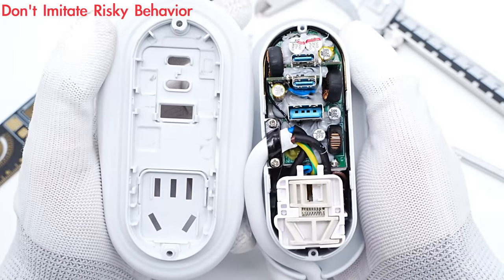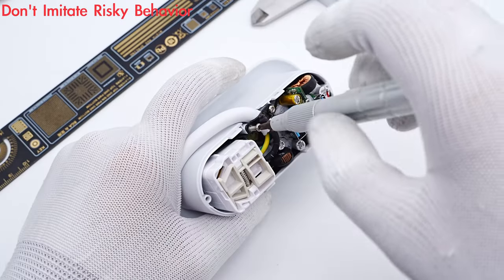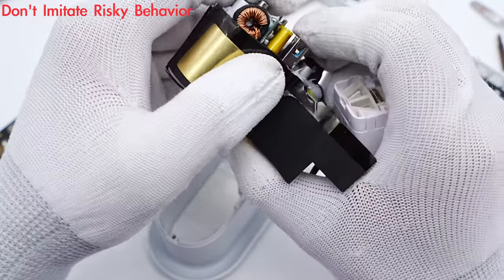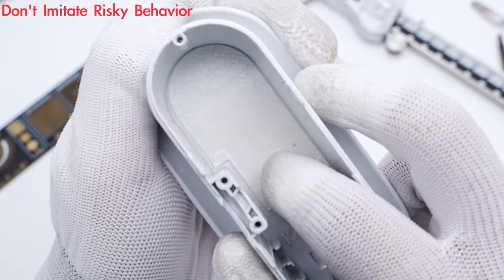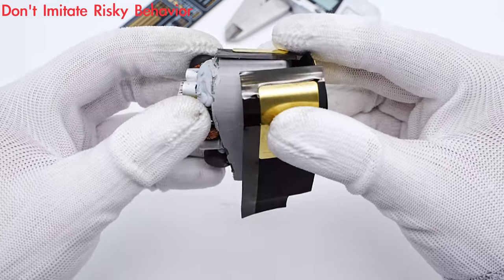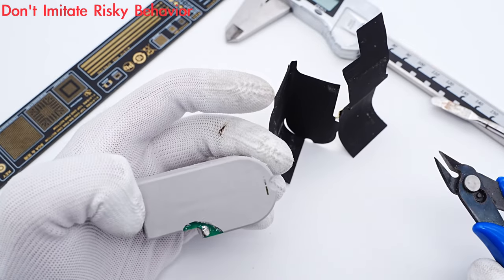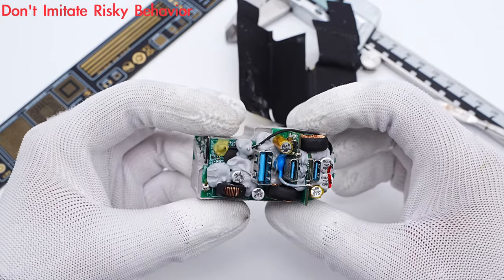As you can see, the rubber sleeve and top cover are joined together. The AC module is on the left and the USB module is on the right. Remove the remaining screws and take out the internal module. The AC module is insulated with a plastic shell, and there is a piece of white film attached to the inner frame under the USB module for buffering. The AC module is connected to the USB module by wires to provide power. The USB module is filled with silicone adhesives, which insulate it from the brass heat sink by a mylar sheet. Removing the heat sink, these silicone adhesives enhance heat dissipation and fix internal components to reduce drop damage.